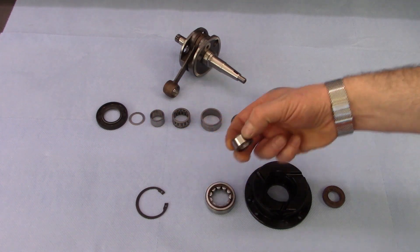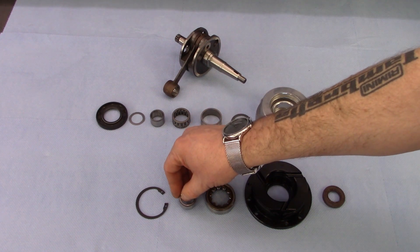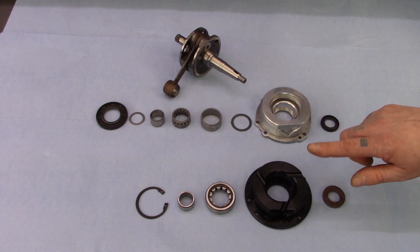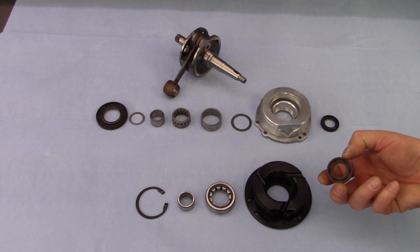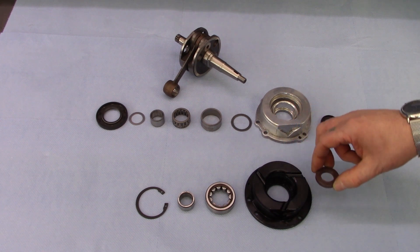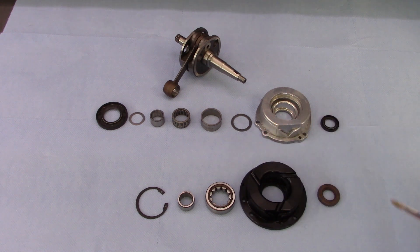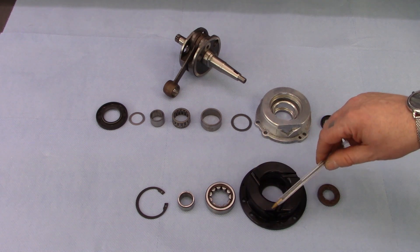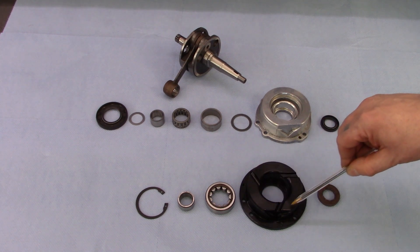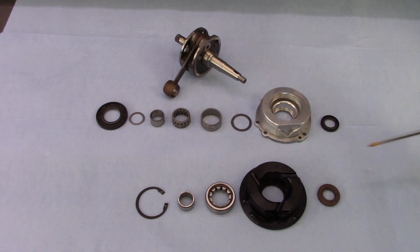The track goes onto the crankshaft and is fitted without a shim underneath. The main advantage of this setup compared to the original is that it has only one single oil seal, which is a double lipped Viton oil seal fitted to the outside. There are also three large grooves machined on the inner face to allow petrol mix — the oil within the petrol — to enter the bearing and lubricate it.